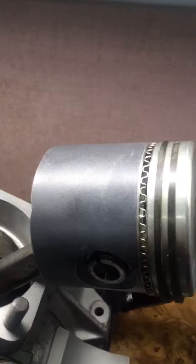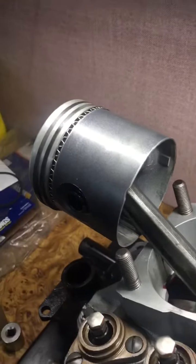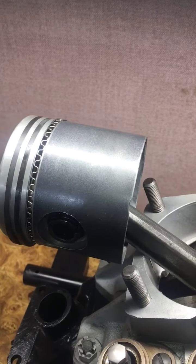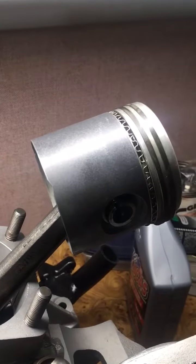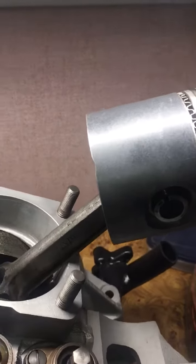And what I can show you is a couple of the modifications that I did to these pistons. First off, you can see that the piston skirt has this kind of grayish look to it. I sprayed something called micro slick coating on the piston skirts. It holds oil better and helps to lubricate, and it's impregnated into the metal so that under load, even if oil pressure drops, the piston is lubricated.